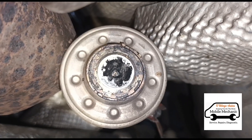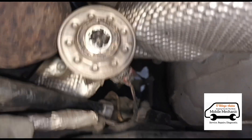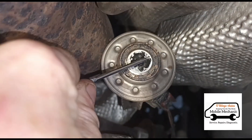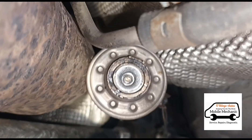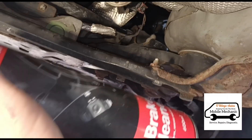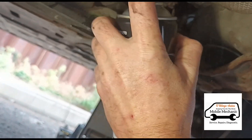You can see this here is going to be the problem — it's a blocked AdBlue injector. I'll get in there with this pick and just pull that off. Now I've got all of the decrystallization pulled off. I'm going to use a little bit of brake cleaner just to wash it off.